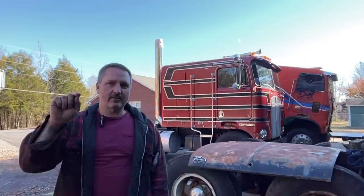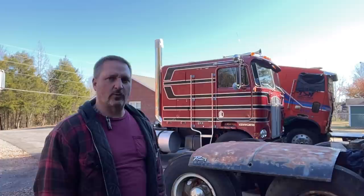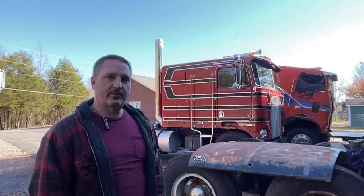See in the background, you see Delores over there, and I think today is gonna be a Delores day. I've got a 13-speed transmission. It's sat around with water in it for a long time. I think I'm going to take that out of the shop, get the pressure washer out, and degrease and clean all the gears in there and give them a look-see, and then dry it out and fill it up with the oil and put it in that thing.